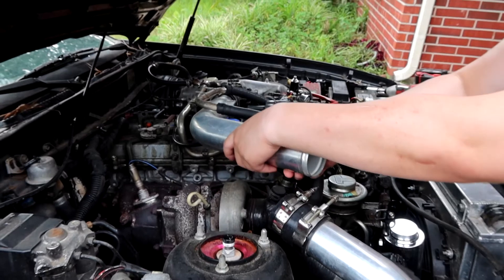Now just going to go through the new turbo, swap all the coolant lines, oil lines, and do whatever else is necessary, then throw it in the car. Also guys, before we get to the install, I wanted to show you the shaft play. This thing is super mobile - not good. In and out has a little bit. But mainly the forward and back, or up and down, is way out of spec. Absolutely terrible. Just for reference, even the eBay turbo doesn't have nearly as much - just a little bit, doesn't click, doesn't make a sound. It's all good. Let's get everything swapped.